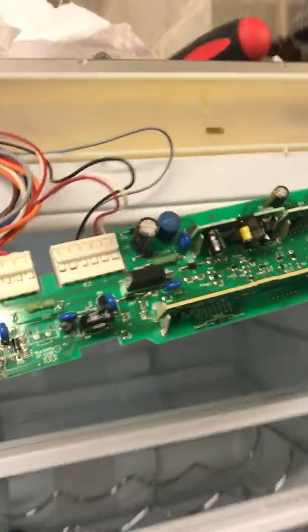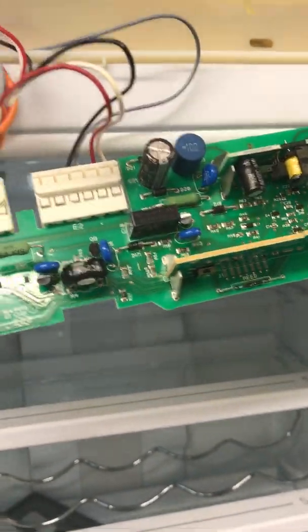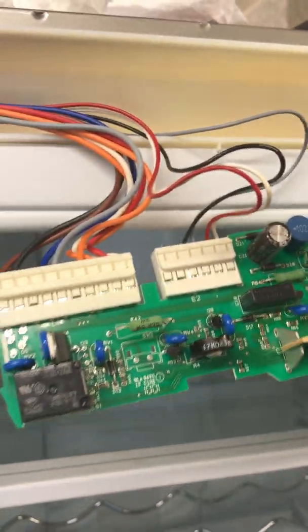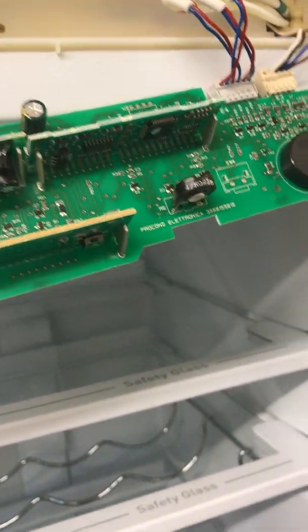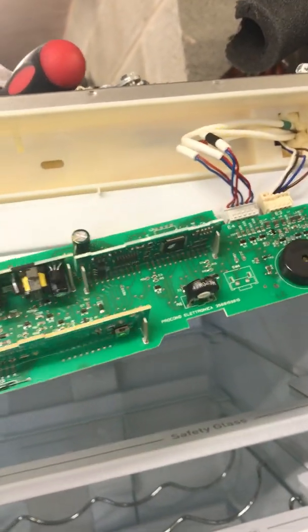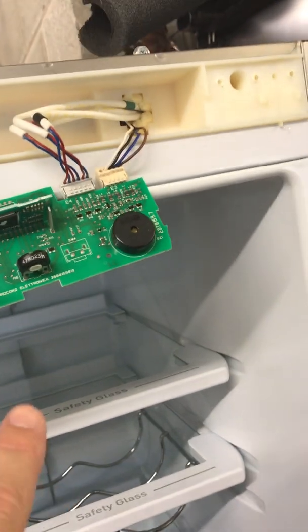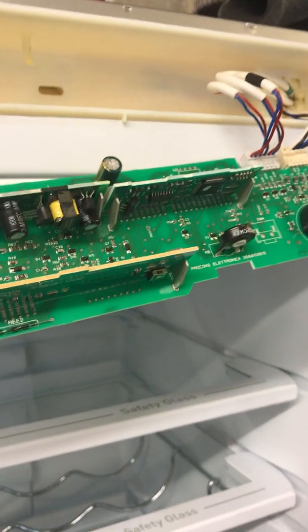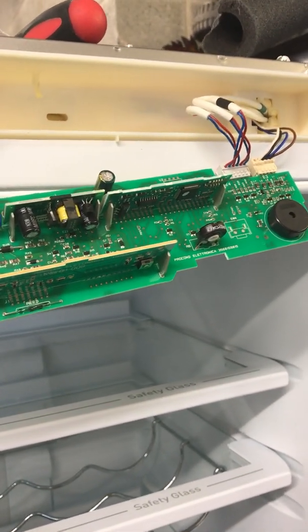The 30th of June 2020, just trying to get this Hotpoint Future Frost Free FF200 LG working reliably. Got it a couple of days ago secondhand. What was happening, as per my other video, was the lights were flashing on it — green, two yellows — and it wouldn't turn off, it wouldn't do anything. The compressor came on after eight minutes but then it was just in a fault mode.